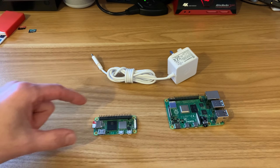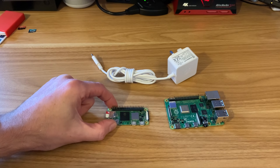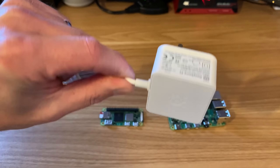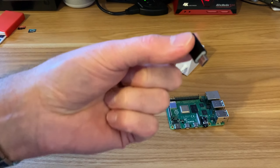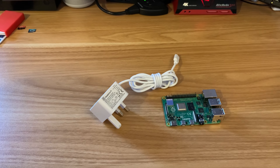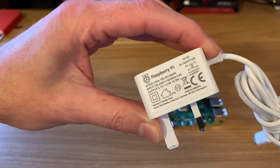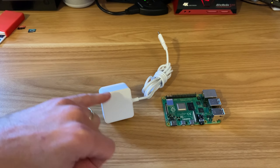Powering a Pi is very easy. On the Pi Zero 2W, pretty much any mobile phone charger will work — I've even powered it from a TV USB socket. It uses micro USB, which is an older connection. If you buy a separate adapter, I'd always recommend the official Raspberry Pi 4 adapter, which is USB-C. You can use a micro USB to USB-C adapter for the Pi Zero 2W. The Pi 4 is more fussy with power — if you have a modern USB-C smartphone or tablet charger it may work, but the official adapter provides enough power for various peripherals and causes much less trouble.